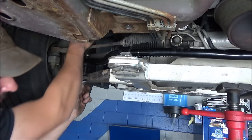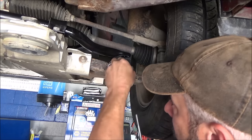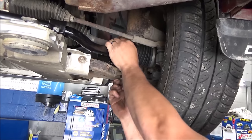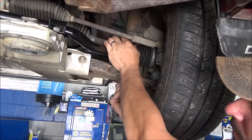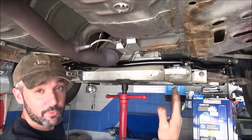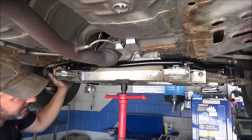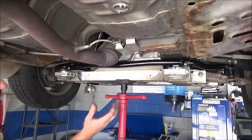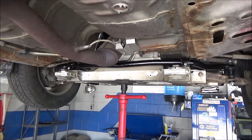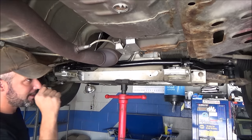Now that everything's started, you can see this sway bar over here is tipping in quite a bit and this one's pretty much vertical. I'm just going to move the bar over slightly to get things evened up. Obviously when we raise the frame back up they'll turn and tweak just a little bit, so we'll just get them so they look exactly the same. I'm going to go ahead and tighten up the sway bar now, tighten up our links, push the frame back up, tighten up the links, and we're done.